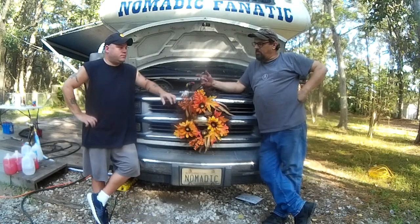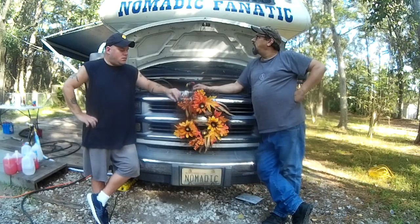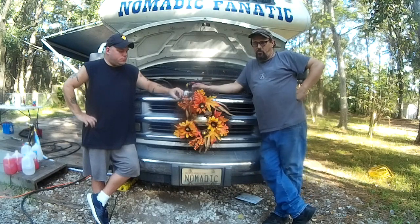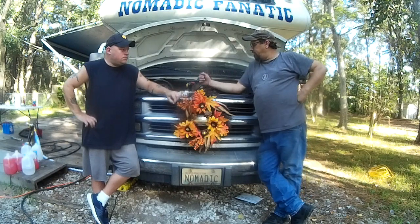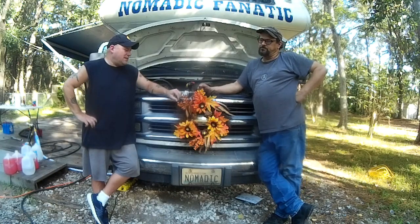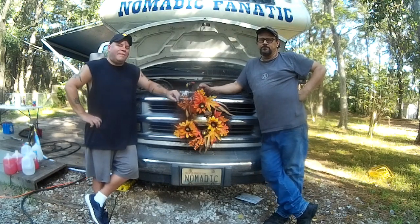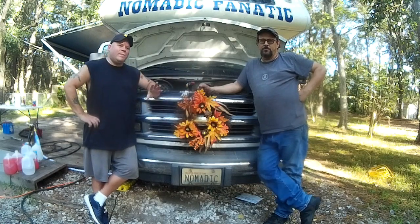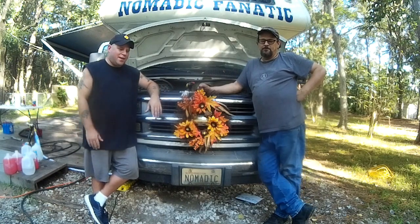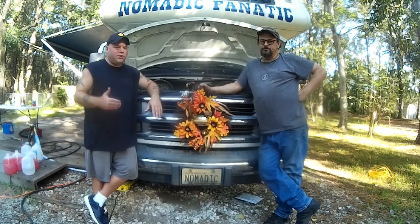Dwayne here. I'm here with Eric, Nomadic Fanatic. Hey guys. We have his 2001 Tioga on a Chevy chassis with 454. And Eric, you want to give him a brief description of the problems you were having? Yeah, well, I've been dealing with this fuel delivery system problem for over a year now. I've done all sorts of things to try to correct it, but basically, after this engine is warm, sit it for any more than about 5 minutes and any less than 8 hours, trying to turn it over, it just feels like it's basically flooded or really starved for fuel, a combination of both.